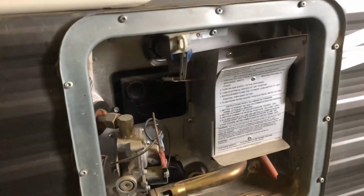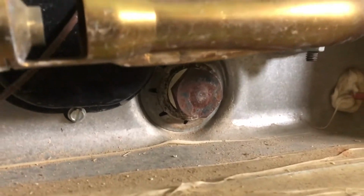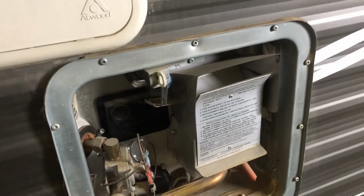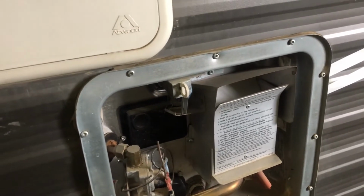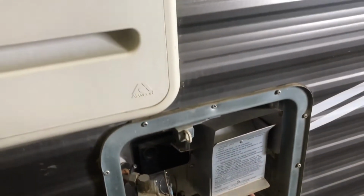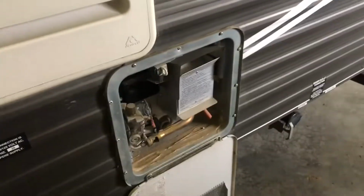So over here at the hot water heater, we have to take out that nut right there and empty the hot water tank, and for me that's an 1 1/16 socket, so I'm gonna go ahead and take that out, and a bunch of water is gonna puke out because it's gonna dump your tank, so you wanna make sure you have all electrical and stuff away from there.